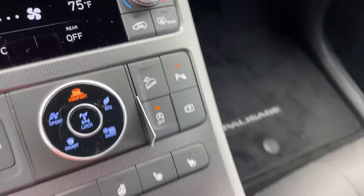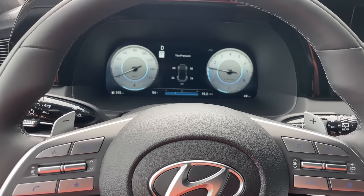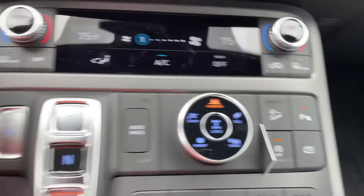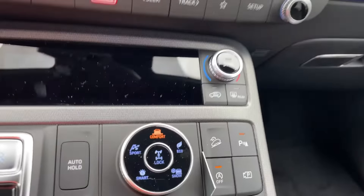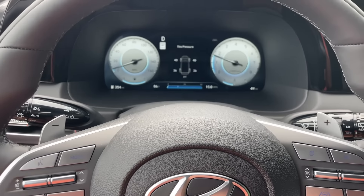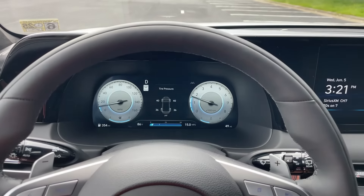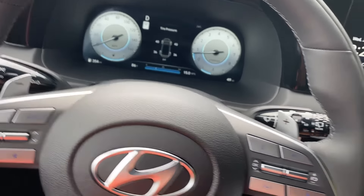I've got to push the button down and do that, and you see how the button stays depressed. However, light is off means the engine's going to turn off — so you've got to make sure the light is on as you put this in place. Now I haven't even turned the car off. Come to a stop — engine stays running, just like normal. Engine stays running, that light is on. Go to park, turn the car off. Open the door to shut down all the electronics, shut the door, turn the car back on. That light is still on because that button is still depressed. Put it in drive, come to a stop — engine stays on. That's the fix, and it works in this Palisade.